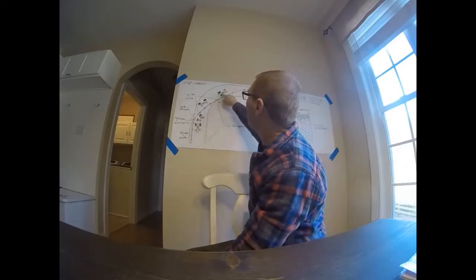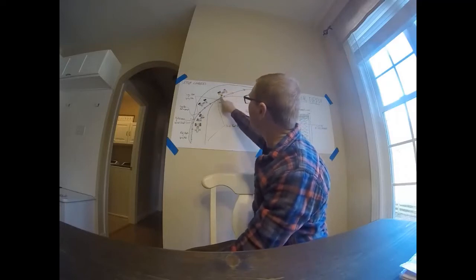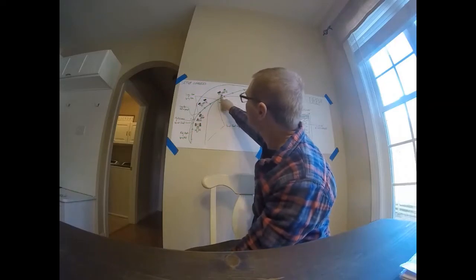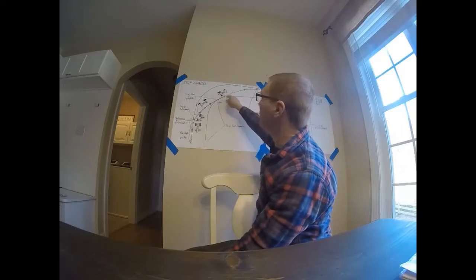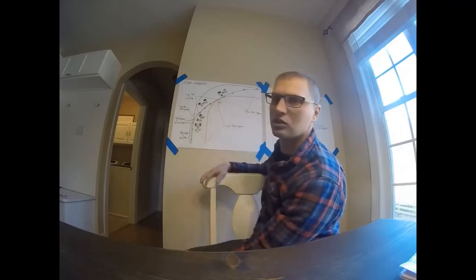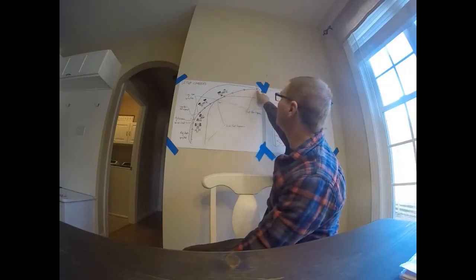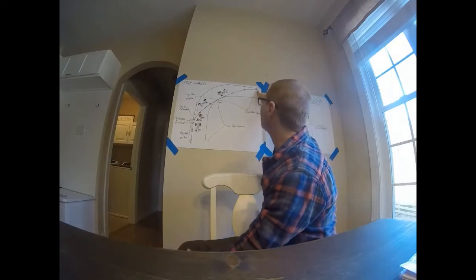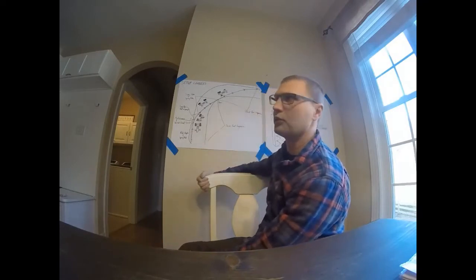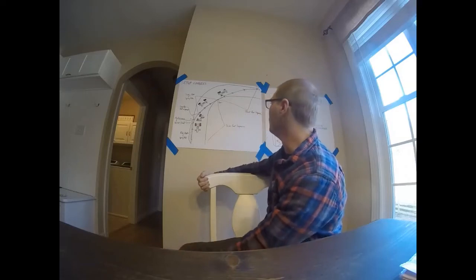Again, you can see we're using our left side tires here, but the load is also transitioning to the back, so we're also starting to put some load on the right rear tire. I'm primarily thinking of shocks or rear settings once I get out to here. Once you get to track out, your drag racer, NASCAR racer, you know, pin the throttle down, utilize your drafting, time your moves, that sort of stuff.